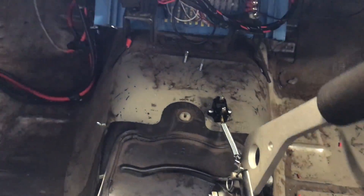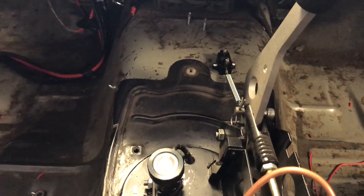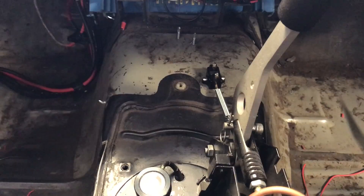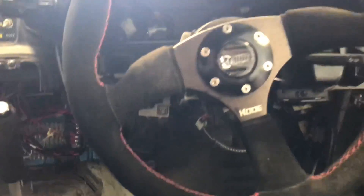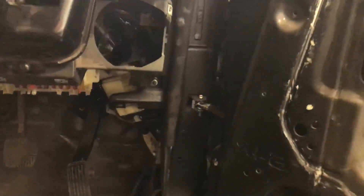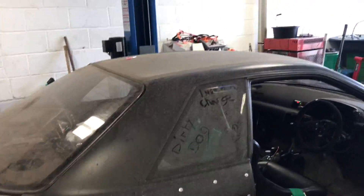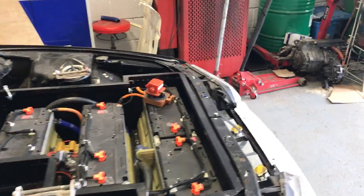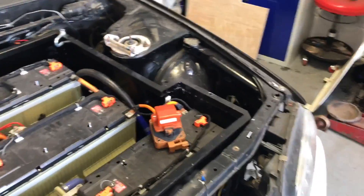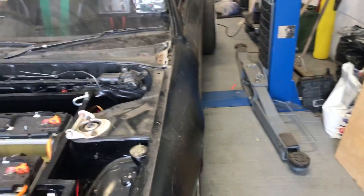It's a nice straightforward hydraulic handbrake, not all plumbed up yet, but there's a little switch I'm about to plumb in that will do full regen — or whatever regen level I set — when I pull that lever. So theoretically I shouldn't need the hydraulic handbrake; I'll get a bit of a play and see if I can actually lock the wheels up with regen. We've tested the throttle pedal and we've had a bit of fun drifting around — that'll be tagged on to this video as well. Seats in, harnesses on, all the cooling systems in, everything working really well so far.